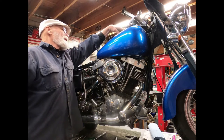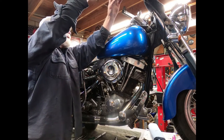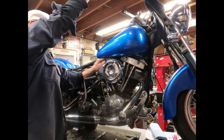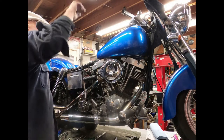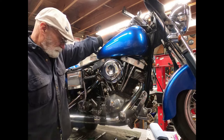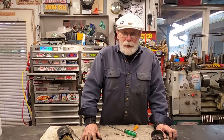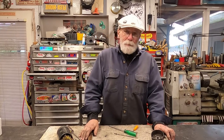Okay, well, let's see if we made a difference here. Whoa, that made a big difference! Whoa, that made a big difference — definitely happy with that. Yeah, that spins it right over; before it would just lug through it. Holy moly, now that was worth the money. Yeah, those starters are really nice. These are like a 0.8 torque starter and that's a 1.4 — they make a big difference.